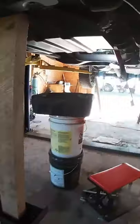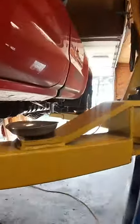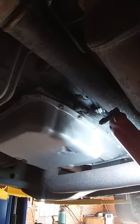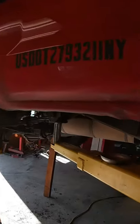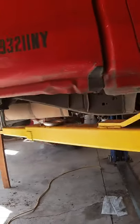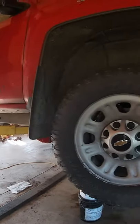We're staging here. I've got some safety things set up because this is a heavy vehicle. We're getting ready to drop the pan, and I bet the ball valve is stuck in the separator plate in the valve body, so I've got to pull the valve body. We'll clean it all out, and I've got parts on the way - the overhaul kit, which comes with new eight check balls and a new separator plate. They just wear out on these transmissions.